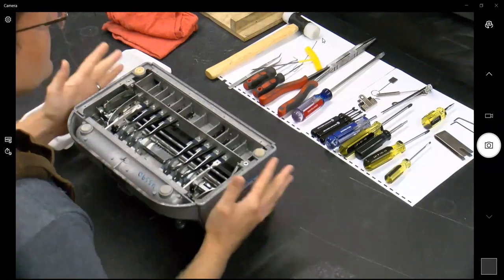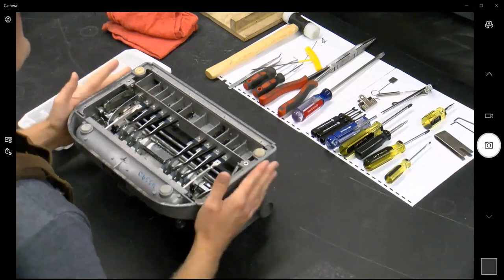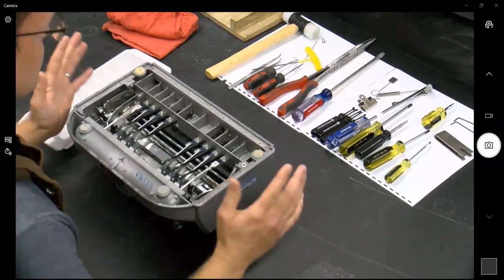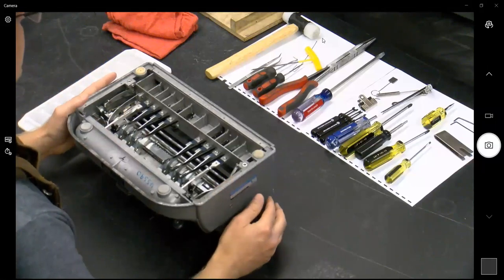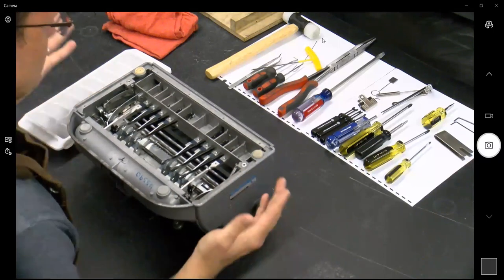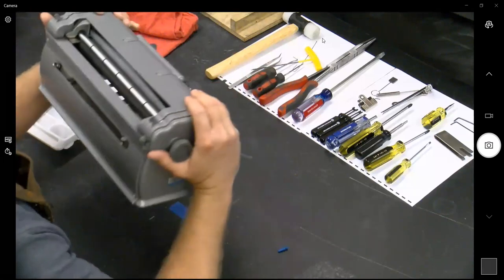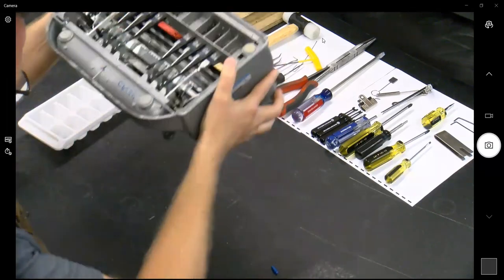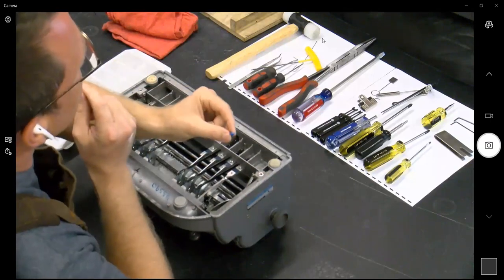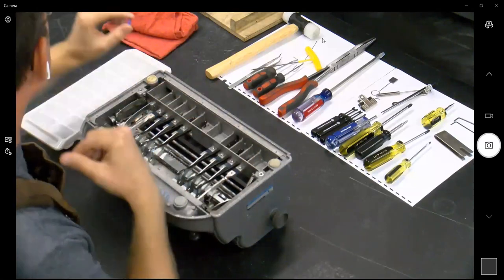When you get into this, even just cleaning, make sure you give yourself enough time to complete the work. That's the most frustrating part — feeling pressure to get it done fast. With the bottom plate off, you can shake things out. Something actually fell out here — a little peg! Believe it or not, that little thing can do a lot of damage: it can get up underneath the keys and when you push down, could potentially bust off one of the link fins, causing a bigger repair.